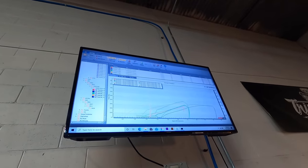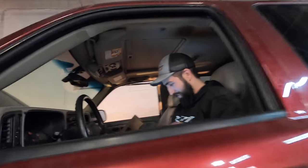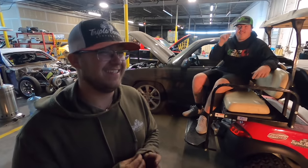370 horsepower — that looked really violent. What did you do? A first-gear pull so it wouldn't load the motor as hard and not demand as much fuel. It moved a lot — a lot of slack in those straps. I really wonder how much boost we're actually making — I feel like it's more than what the spring says. Maybe my wastegate priority isn't that good. It's a Tial — that should be interesting. So we can't do much else — we need a fuel system. Can we at least go drive it?